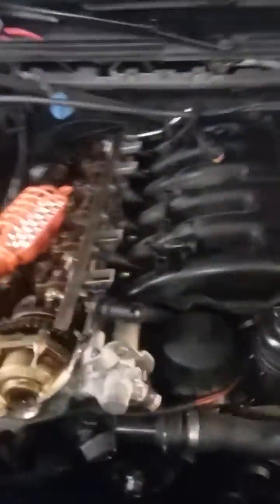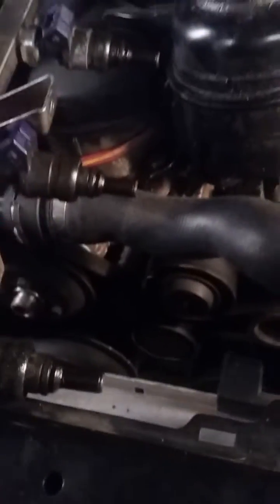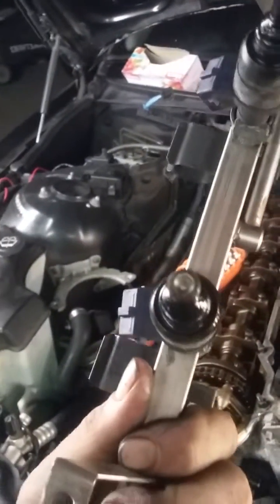And that's how you get the fuel rail off — not that hard. A little common sense, guys, that's all you need with BMWs. Watch out when you take it off because it's gonna be dripping a little gas. Also, anything with rubber seals like this — take some penetrating oil and lube it up, especially if it's gonna be out of its place for a while. You don't want the air to dry it out and dry rot it. Look at those pretty injectors!